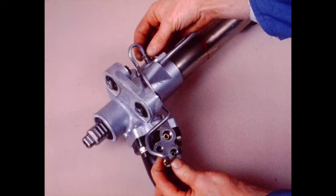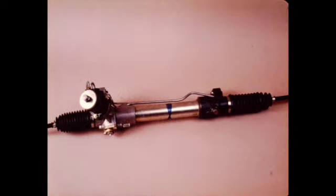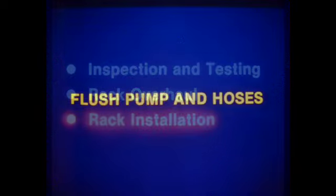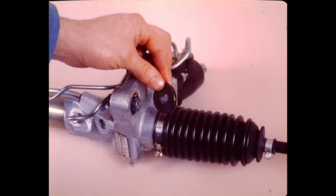Install the hydraulic pipes, noting that the port in the aluminum housing has fine threads and requires a seal. Complete the rack unit reassembly and adjust the damper as previously described. Certain precautions and procedures should be observed when installing the rack unit in the vehicle. Flush the pump and hoses to remove any contamination. The return hose will drain straight through the pump. Flush the pressure hose by cranking the engine. Do not start the engine and do not run the pump dry. Check the condition of the rack bushings and rubberized float washers; replace as necessary.